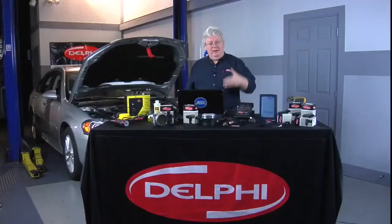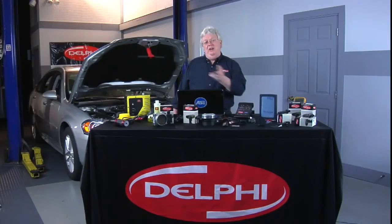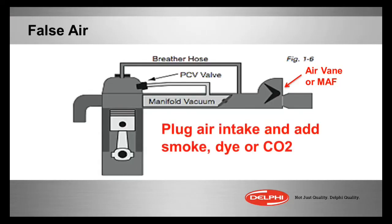As a matter of fact, anything in the entire intake system — whether that be an injector seal at the bottom of where the injector plugs into the intake manifold near the head, or something in the fresh air side of the system. Not just a breather hose falling out of the rubber tube between the mass airflow and throttle body, but something more obscure like a crankcase seal, valve cover gasket, or oil pan seal gasket. Anywhere false air can get into that engine, it will affect your readings of grams per second and the air-fuel mixture. So do thorough leak testing when you see low grams per second and high trims.